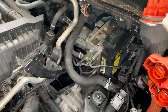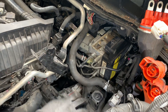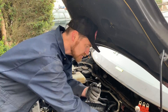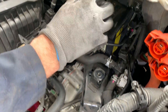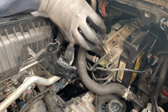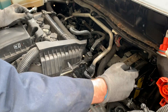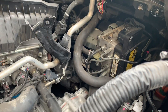There are bolts that hold the whole Y-shaped frame the ABS is mounted to — one here, one in there, one down there — and various other bolts holding brackets to that frame. My next step is to break loose the brake lines. Best practice is to always use a line wrench so you don't round off the fittings. I crack it free with the line wrench, then switch to a shorty wrench for faster turning. I'll remove all the brake lines and then pull out the ABS unit.